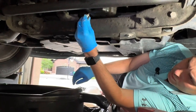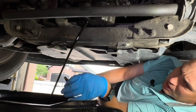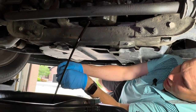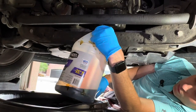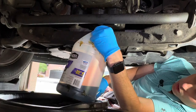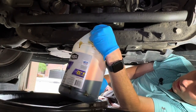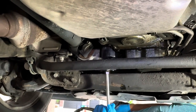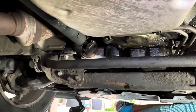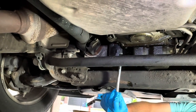The pan's lined up to the hole. I got a little bit outside the can — that's okay. I'm just going to fill this catch can, just an old jug, that way it'll save me from having to pour it in there later. It's been a few minutes, oil's almost drained out. The nice thing is the drain plug's right next to the oil filter, so your oil pan can be right below both, and you can work on the oil filter at the same time this is draining.